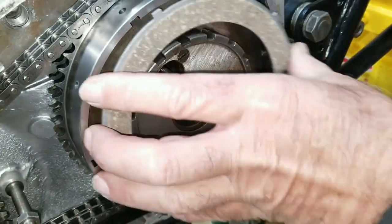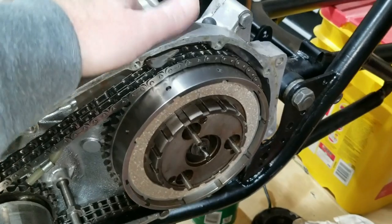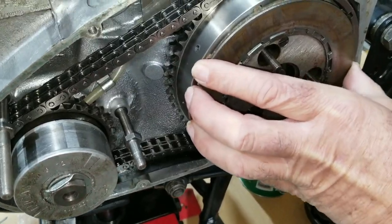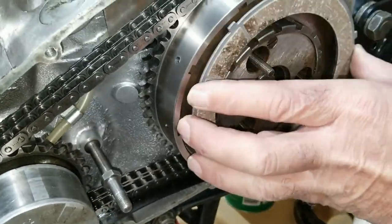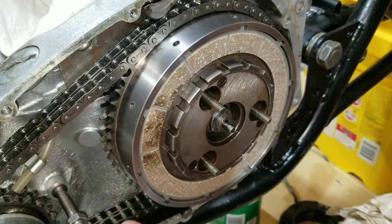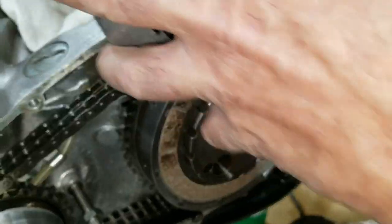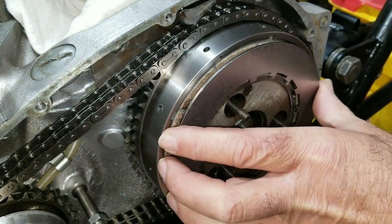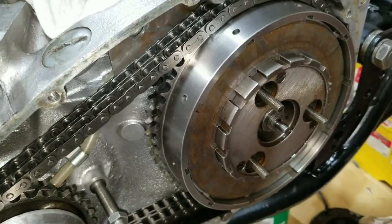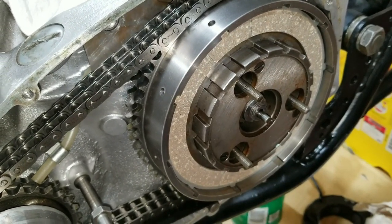The breather, yeah, that's what it was, the breather. So when they did that, it actually took oil holes and, yeah. So what happens is it needed to be a dry clutch, and we ended up putting a wet clutch in. Before, it was separate oil, and you could put oil in it that didn't touch the clutch. Now it mixes the motor oil with the transmission all the time. So with that, you need a wet clutch. And we were running '70 and older style clutch discs, and it wasn't working right with the wet. So anyways, it works better now.